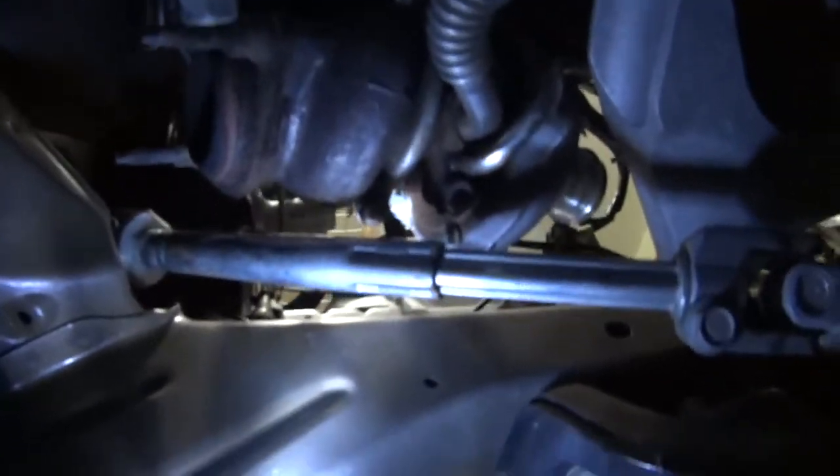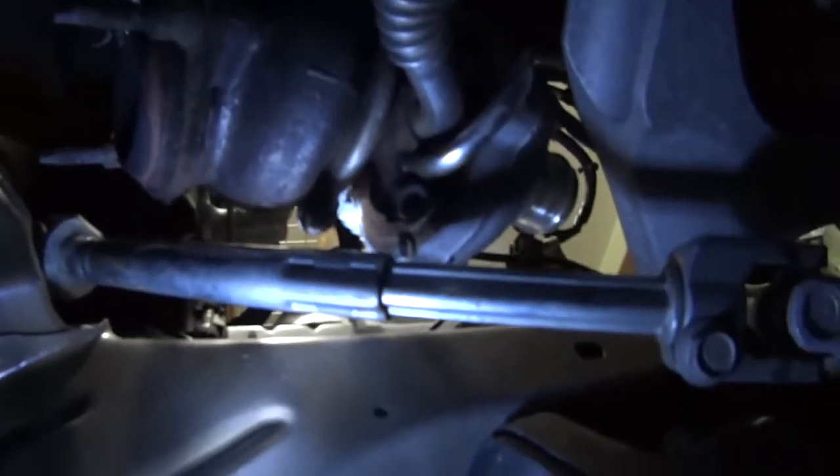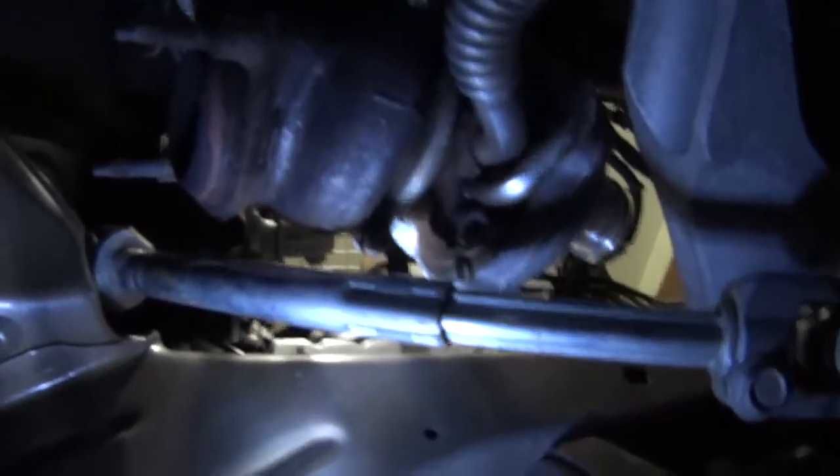So it's going to be extremely tight on the 11-14 with the adapters. I do still think it will fit — you're going to want to talk to Eric about how thick exactly the spacer is. It is quite tight in there, and that's really the only issue you're going to run into fitting these turbos in this car using the 3.7 and adapters. If you're one of the beta testers, this is probably going to be where you want to look for clearance issues. I do believe it should still fit — it's just going to be very tight.